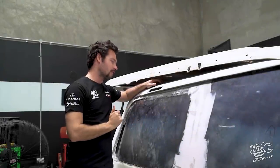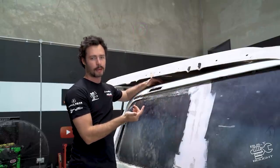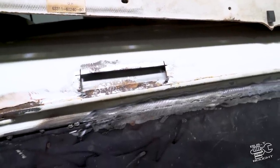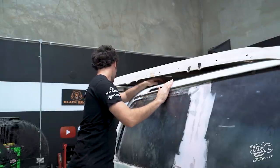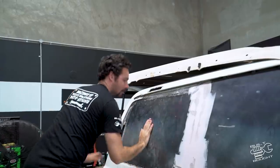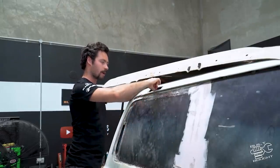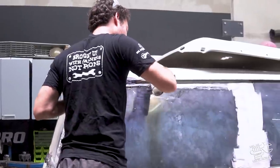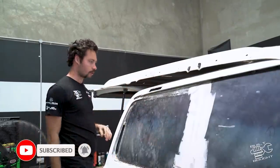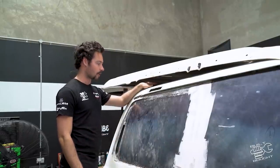I wasn't going to show this specifically on video because I thought it was just a tidy up, but so many people were asking about it on Instagram and in the comments from the last episode - doing this little rust repair in the corner here. Essentially it's going to be treated the same as when we filled in that door handle. Once you've cut the rust out and cleaned it up, you just want to plate it up with a piece of steel like that. I've cut out the rust - you want to get rid of it as much as you can. If there's a bit of surface rust left, just spray a bit of paint on it and once it's sealed from the atmosphere it'll stop oxidising. Cut up a little piece and tack it in, then grind the welds back, give it a bit of bog and continue from there.